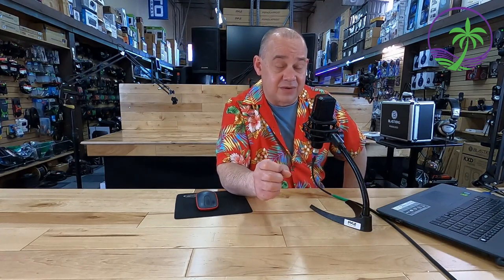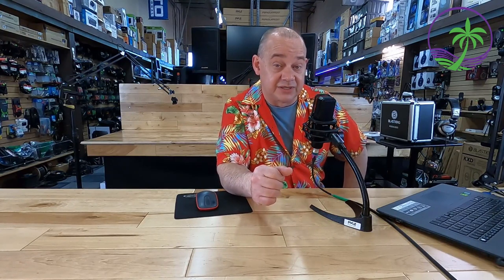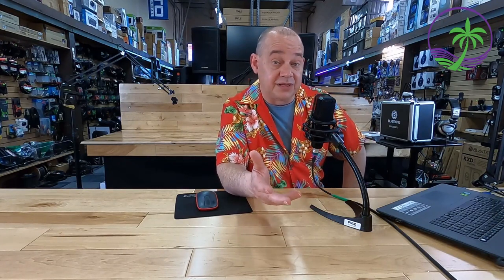The speaker itself is pretty generic — it's a good party speaker for your home or backyard, but it doesn't have super bass or anything special. The rechargeable battery is a standard type used in all these speakers, about seven and a half amp hours running on 12 volts. What most manufacturers don't tell you is the real runtime. We've tested these speakers — if you're running it at 25% volume you'll get about eight hours of play time. Turn that volume up to 75% and expect more like 90 minutes at best. Also, don't run it on batteries until you're absolutely ready to use it, because the battery may die. Long term these batteries are notorious for memory build-up, and you'll be spending $20–$30 to replace it — you certainly don't want that happening during an event or ceremony.